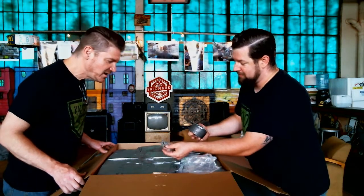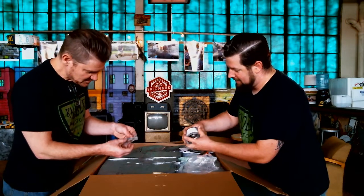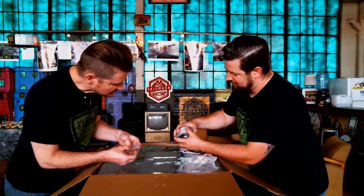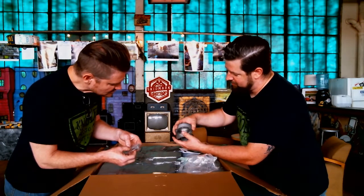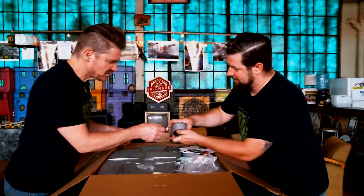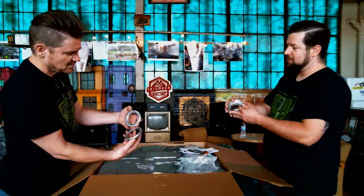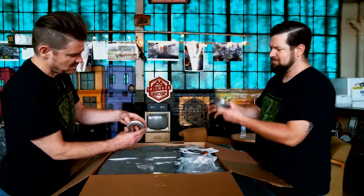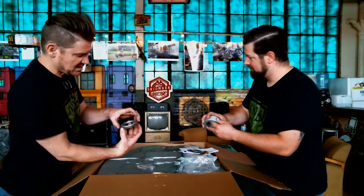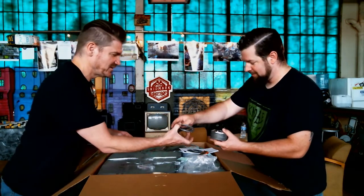Hardware right there. Little never-seize packets — you can actually take it apart again. There's a little gap in between all the discs and that's really where your flow is. So you can add and remove discs to tune your bike in to the way you want it, in whatever setup you got. So if you go big bore, higher cams, more discs — get that flow in there. So cool.